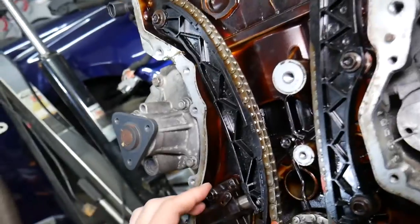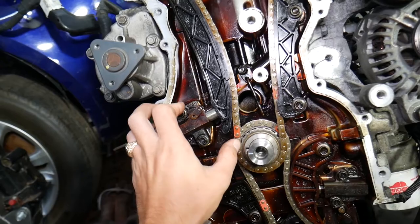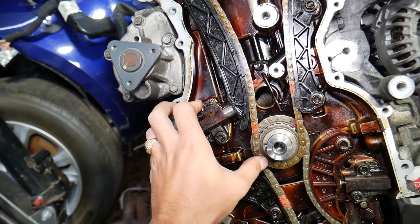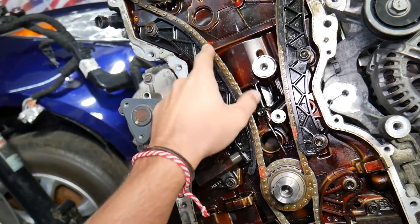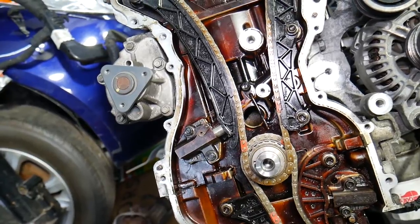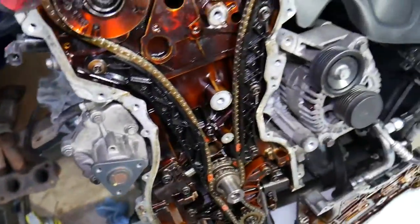But not just the tensioner — you need to replace the whole timing chain assembly in my opinion. Most people think timing chain is a lifetime deal, but it's lifetime until your engine fails. Do your research; on BMW for instance the tensioner fails at about 70,000 to 80,000 miles. If it were my vehicle, I'd replace it anywhere between 60,000 and 100,000 miles, depending on whether it's highway or city miles.